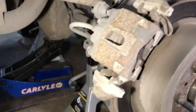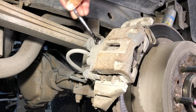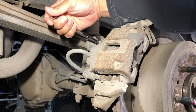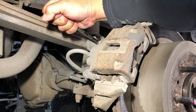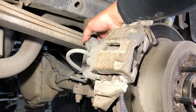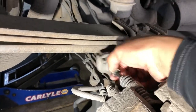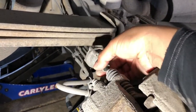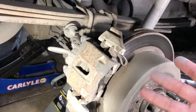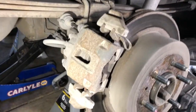It's very important that you use a wrench with these anti-slip teeth — a regular open-end will round off the hex. So I'm going to set the camera down because these tend to be kind of tight. Just get a good bite with your 10 millimeter wrench and generally these ones with the serrations won't slip. Once that's loose you can just spin it out — it hits the leaf spring, but that's okay. Once it's moving the caliper will come off once you get the bottom bolt off.